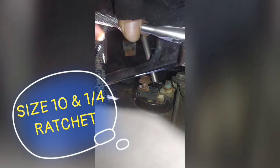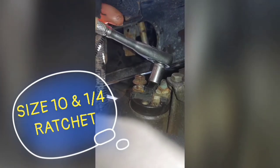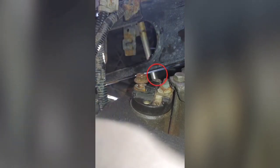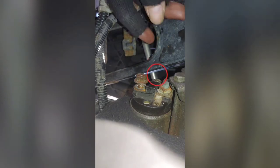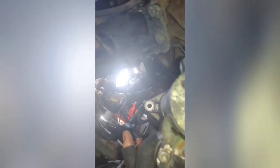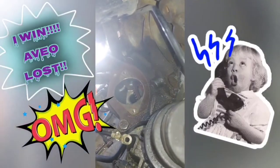You use a size 10 with a little quarter-inch ratchet while it's barely twisted. You can barely fit it in there, but it's got to be a socket because you don't have much space — an open-ended wrench will not work from that angle. It doesn't take much; unscrew it, release that cord off of there, and at that point it's completely free. Then you twist it and just slowly bring it back.